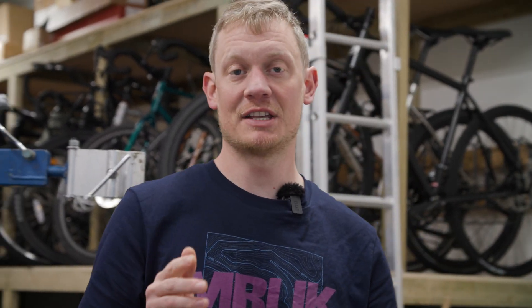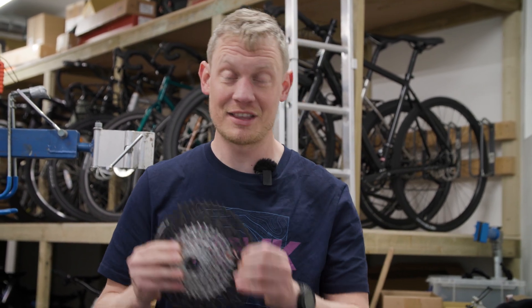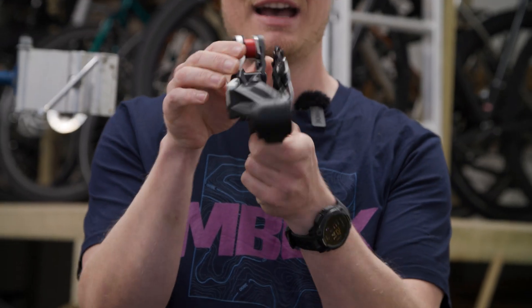If you get the Eagle 70 groupset there is a specific Eagle 70 cassette - 12-speed, 10-52, but it mounts onto a standard spline freehub, so no XD driver required. It'll come in two parts, with gears 8 to 12 being replaceable when worn out. It's likely to be heavier, but SRAM have brought over the cassette shifting ramps and tooth profiles from Transmission to ensure the chain jumps between gears smoothly even under power, along with matching chain profiling.